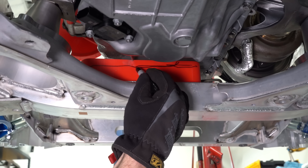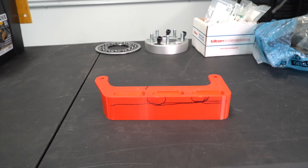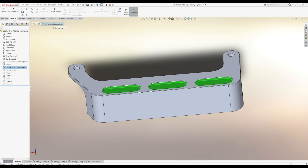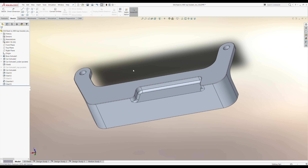For example, the rear rack mount was actually hitting the engine's oil pan once we put it in — you can see where the two notches are and it actually dented it. We went back to the CAD software, added a couple of features to clear the oil pan, and then that was wrapped up.